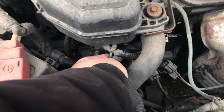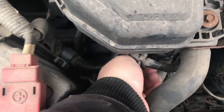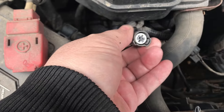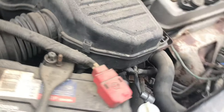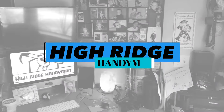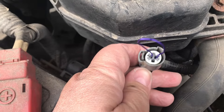There's a little tab you squeeze to pull the plug off the coolant sensor. Once you get the plug off, you can see it has two pins inside. What you want to do is jump those pins using a paper clip. If you have colored paper clips, peel back the plastic coating first. Then plug the paper clip in to bridge from one pin to the other.